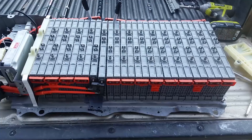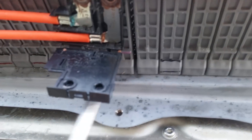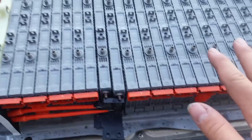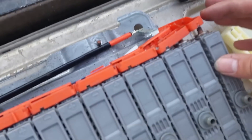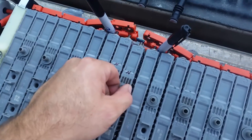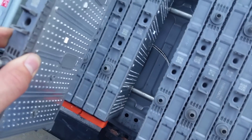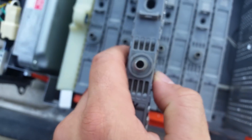Since these cells are already dead and damaged, we're gonna see if we can just pry some cells out without disassembling the whole thing. The answer in short is no — it will not work. I tried prying up on this multiple times on both sides and it will not come out. It's got this plastic on each side that makes it very stiff. What you have to do is take the end cap off using the 12mm bolts, and then the whole block will kind of slide down and give you a little bit of freedom. As long as you can get about a quarter to an eighth of an inch, you can slide these things apart — but it's that plastic on the edge that makes it very stiff between the cells.